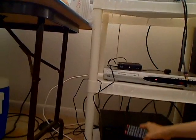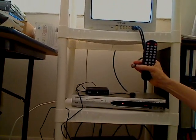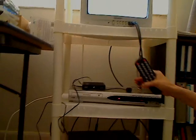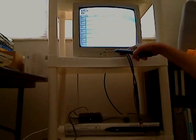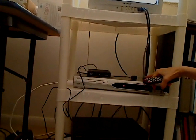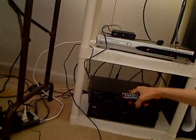The video sound lines — which are these cables right here, which have red, yellow, and white ends — you want them to go out from your VCR straight up to your television's input sockets. You also want video sound lines going out from the DVD player into your VCR.